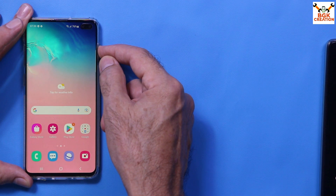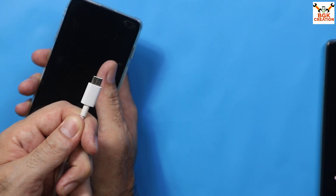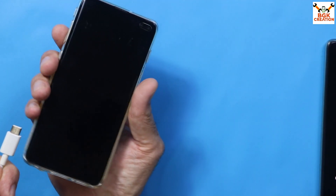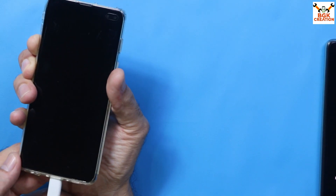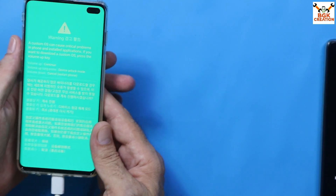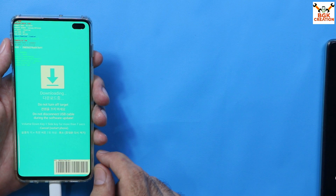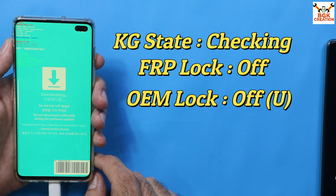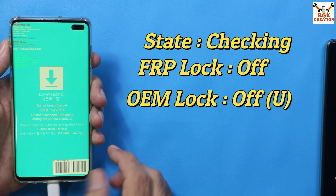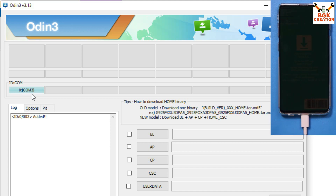Power off the mobile phone. Once it's off, boot it into Odin mode by holding the cable in your left hand with the other end connected to the computer. Press and hold Volume Down and Bixby key, then connect the cable. A warning screen will appear — release both keys and press Volume Up once to boot into Odin mode. The Odin mode screen should show KG State as 'Checking', FRP Lock off, OEM Lock off, and a 'U' in brackets indicating the bootloader is unlocked. Odin should show COM 3, meaning the device is detected.